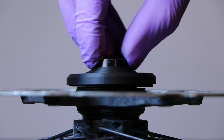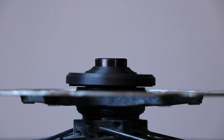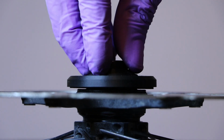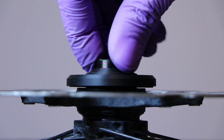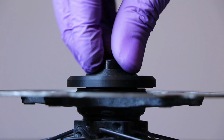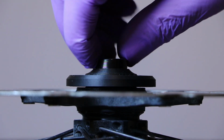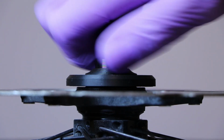Okay. I have managed to pull this up all around, enough to reset the proper installation depth. So the same procedure. Okay, just push right here. I mean here, but we are looking at here. Okay, and rotate, and push, and rotate, push. And that's it. As you rotate this, the ring gear should not wobble up and down. And that's great.